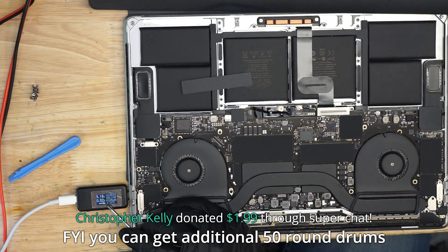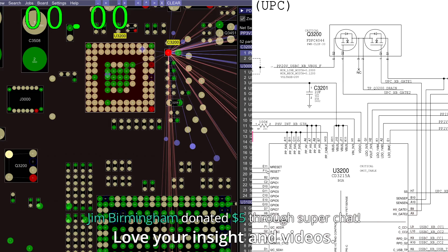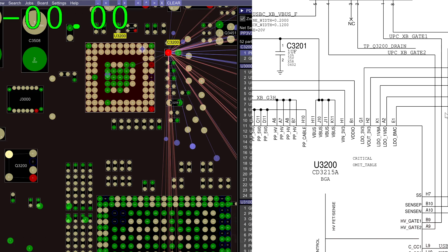The battery's unplugged and it looks like we're taking 20 milliamps at 5.15 volts. 20 milliamps is not very good — it's supposed to be giving us about 200 milliamps and then jump up to 20 volts, which it's not doing. PP3V3G3HOTRTC is right there and that power line is going into the chip to provide voltage. We get zero volts on PP3V3RTC but we get three volts there.